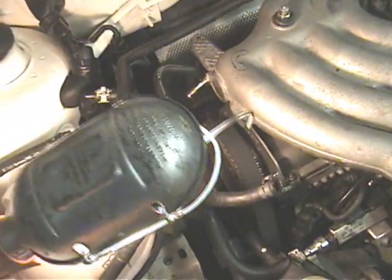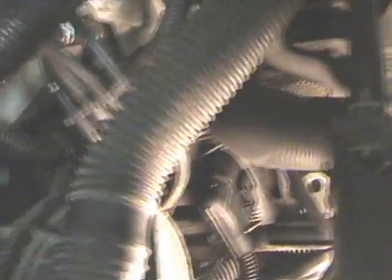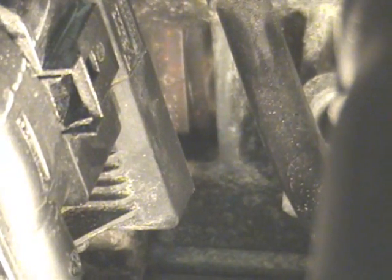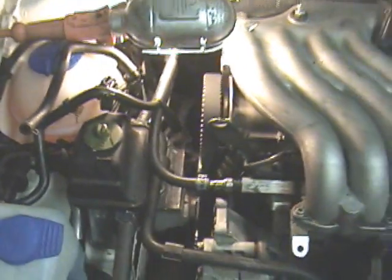In case the crankshaft was twisted, we're going to check it over by the transmission. If you go down in this area and look carefully, you'll see a square window. My assistant is turning the crankshaft with the 19mm socket — a little more, keep going — until piston 1 is now at top dead center. The timing belt is on, the engine mount is back on, along with the power steering reservoir. That one bolt underneath was a terrible pain to do, but it's done.